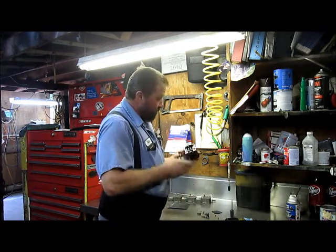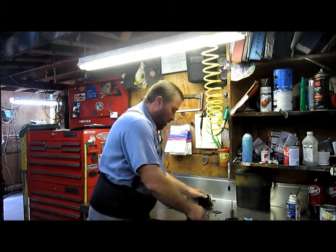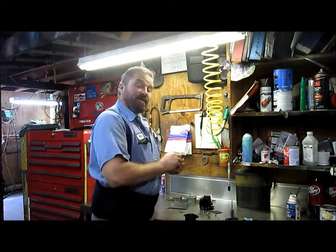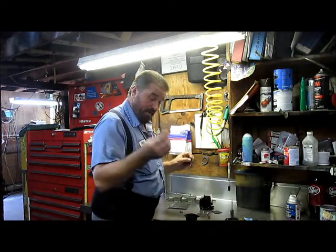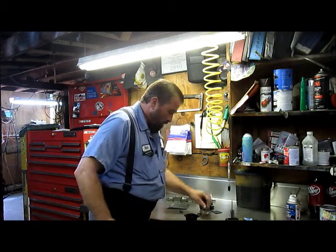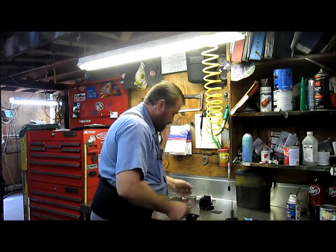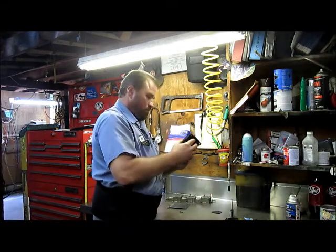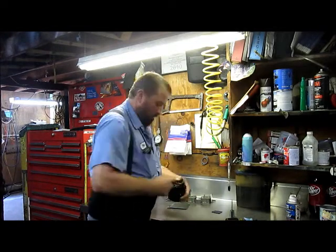Now, before when I was talking about numbering these — you want to keep each carburetor bowl with each carburetor body. You can number the bowl and the body itself. What I like to do is once I get it all disassembled, I'll leave two screws out and take all the rest of the parts we're going to reuse. A lot of kits nowadays come with hinge pins. Save your jets and find out what the jetting sizes are and write them down. Put all that stuff down into the bowl with all your screws, then put the bowl back on with two screws, catty-corner in position.